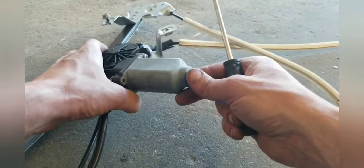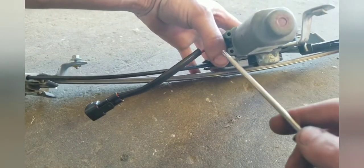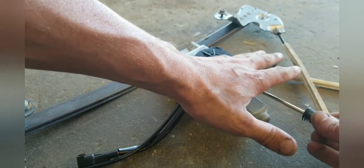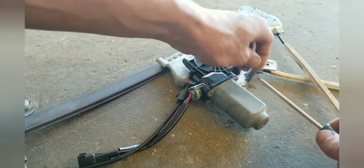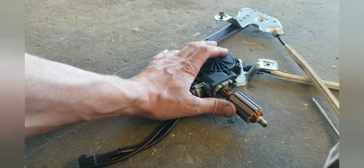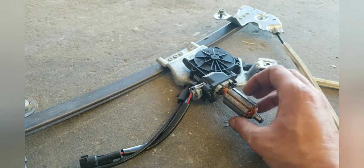On the back side of this motor, I've got three of the bolts taken out but there's four bolts — there's one still in there, then another one there, and then those two on the left side. You remove all four of those bolts and you pull this cover off. It's magnetic so it wants to stick. There are permanent magnets inside of the motor. Now you've got access, and you can just reach in there and turn this.